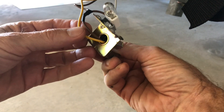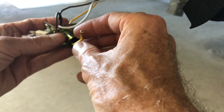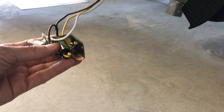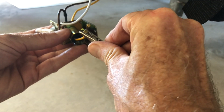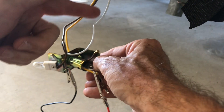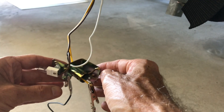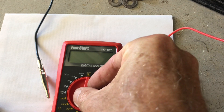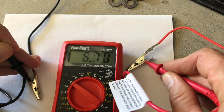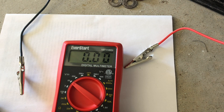What we'd like to do now is test the very end of that yellow wire to see if the light bulb is actually getting electricity. You can see those two wires feed in under there — just push them out and there's the yellow lead. We take our lead and connect it, then connect the ground lead to the base, since the white wires are ground. With the vehicle left turn signal on — there we go — we're getting electricity all the way to the light bulb itself, which leads us to believe the issue is probably with the light bulb.